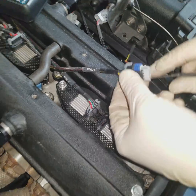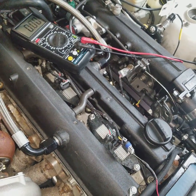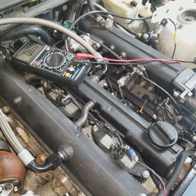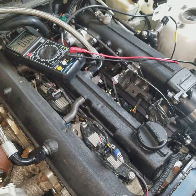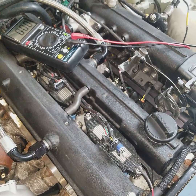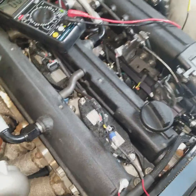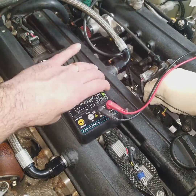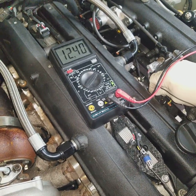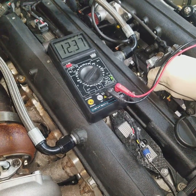We're going to stick the probe in there. I'm going to go ahead and turn the ignition on and then we're going to ground the other side to show that we have 12 volts at the ignition coil. Now that we've got the key on, I can ground this right here — I'm going to ground it to the engine block again. We're seeing a steady 12 volts, so that means we definitely have power at the engine harness and we're going to have power at the PCM as well.